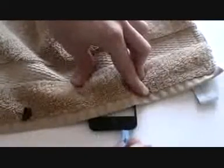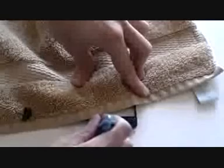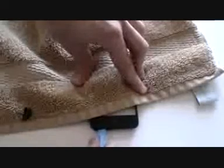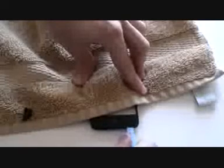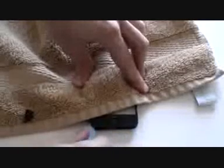Once the glue has been heated, we can start to pry up the digitizer from the plastic midsection. You can use the safe pry tool as being shown here in the video to gently lift this up. If you are having trouble working at one end, you may wish to start at the sides as this can be easier. Once you have released the glue from one end, you'll need to start on the other.